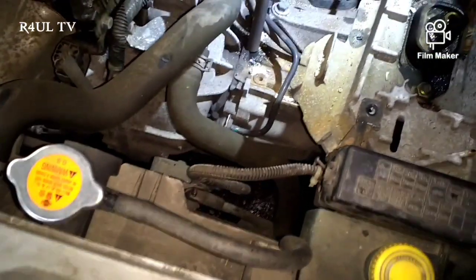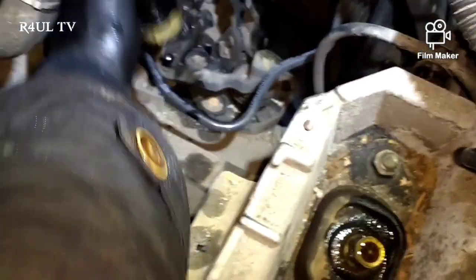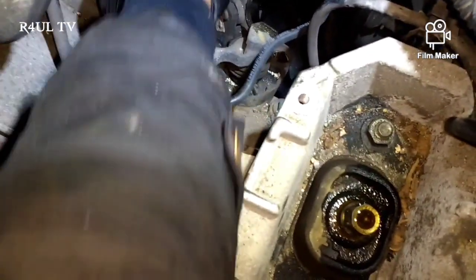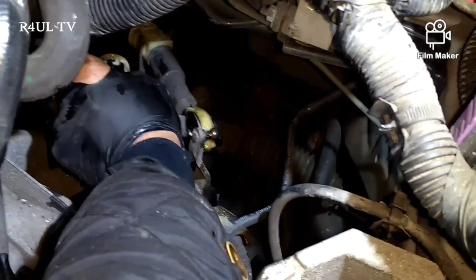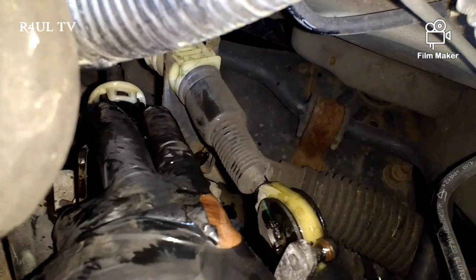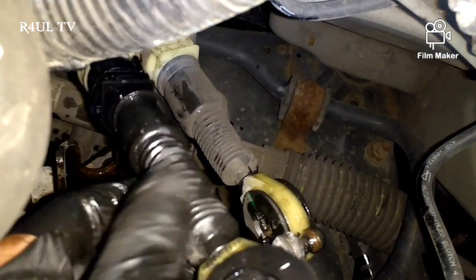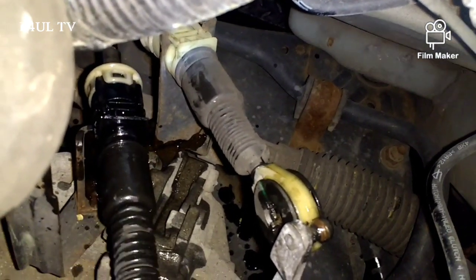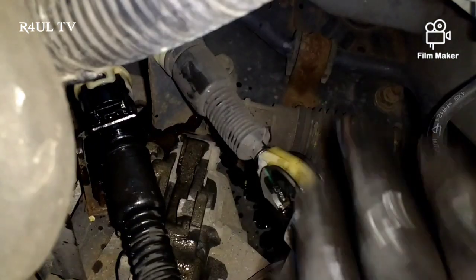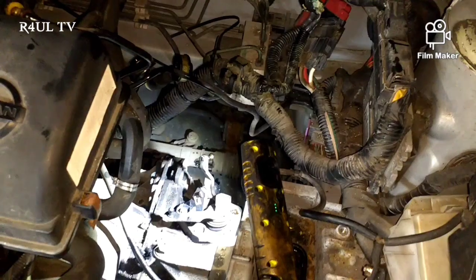As you can see I've took this cable off. The linkage cable - the way you take that off is obviously press down on here and then lift it up like that, so that side comes off. You've got two little clips there - you press them two sides in and then pry it out. Put a bit of oil on it and it will just slide out nice and easy. After that we can see one bolt there and one there - take them two off, the whole bracket comes off. Cable tie it to the side and then happy days.